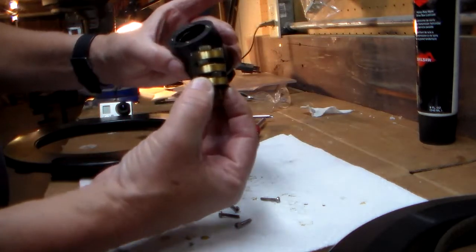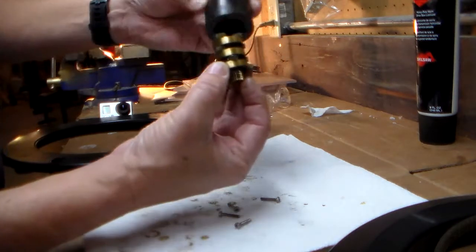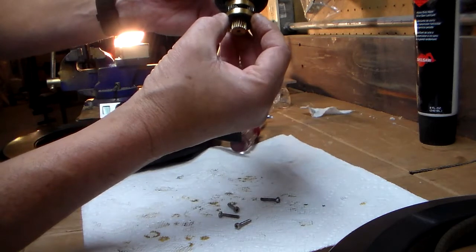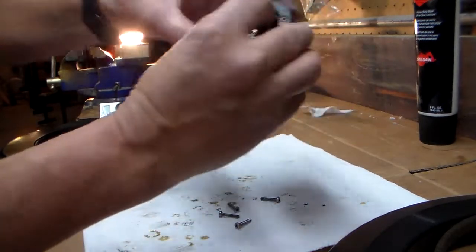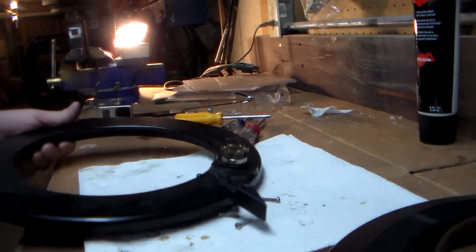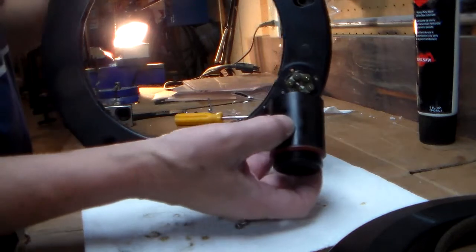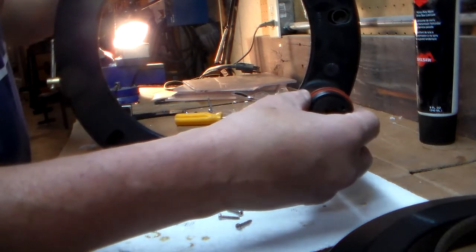Lastly, we feed or slide all of this stack carefully inside the assembly housing. You don't want to force it. There's splines inside the gearbox, but that puts them all back in. And then the last piece is to very carefully put this gearbox on top of these stacked ones. I think the way I did that was to kind of put everything sideways and gently giving it a little movement now and then to make sure things line up.